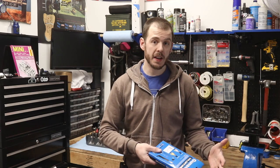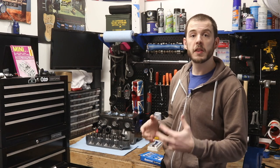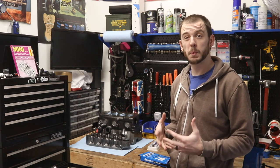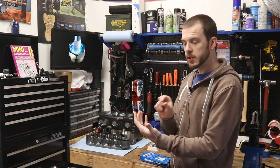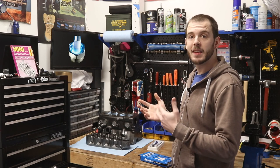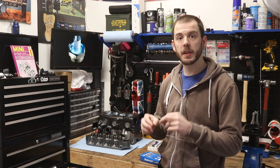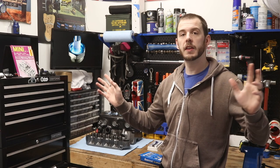For those of us with carbureted engines, this Color Tune is supposed to be really easy to use. The way it works is you insert a special spark plug that comes with the kit, and then you can actually see through it. When the explosion is yellow, that says the air-fuel mixture is incorrect, but once it turns blue, that's when you know it's the correct mixture and everything's running properly, and all is wonderful.